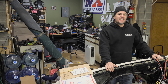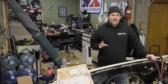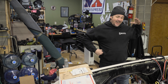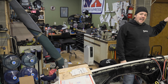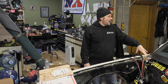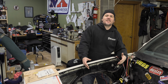I did a little digging. Turns out there was a power short to ground that was causing basically a back feed. You can have a short without smoke and without it burning everything down — a lot of it has to do with whenever there are loads applied and where it's at. It was in the back somewhere. I still haven't found it, but I've isolated it. This car has a battery relocation in the back, goes to a shutoff switch, then comes forward to a lug inside the door, and it's somewhere in that section.